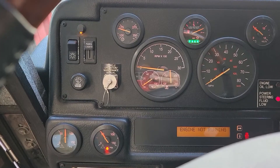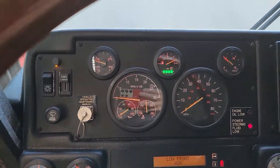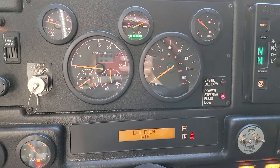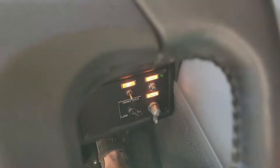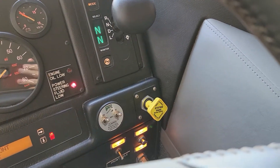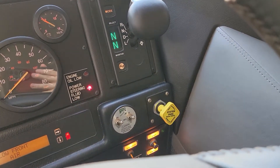We've got the alert for tank number one and there's the alarm. So now I'm going to keep fanning it down until the parking brake applies. We're going to watch the parking brake and continue fanning the brakes.